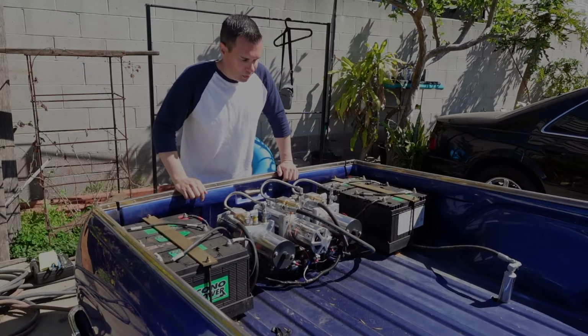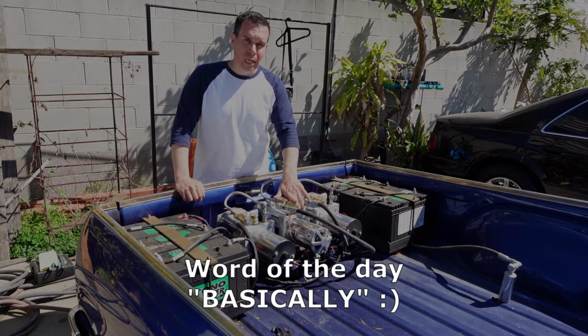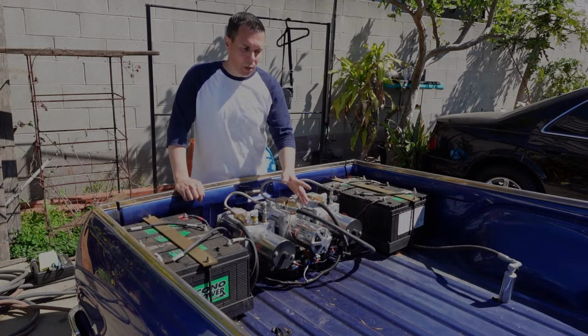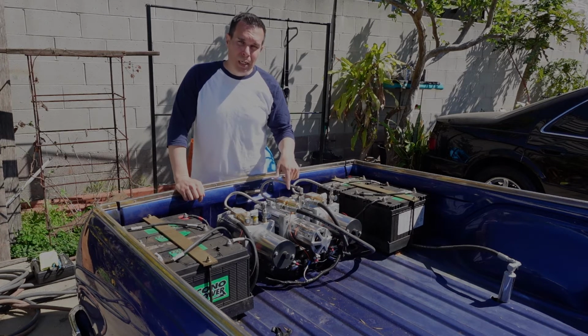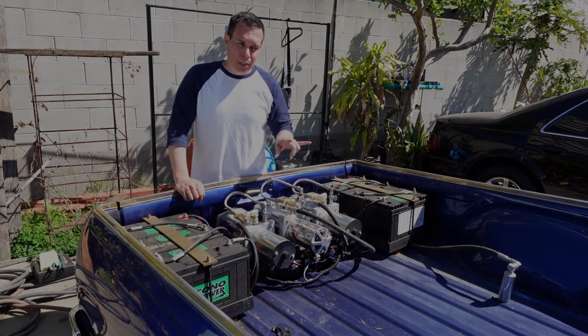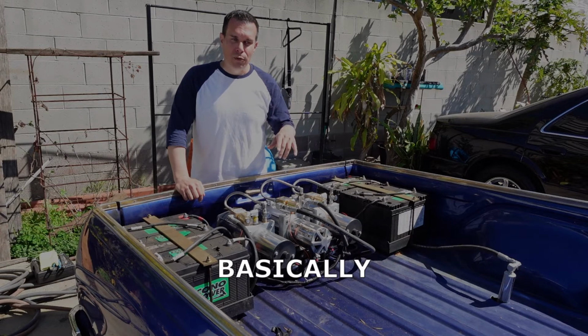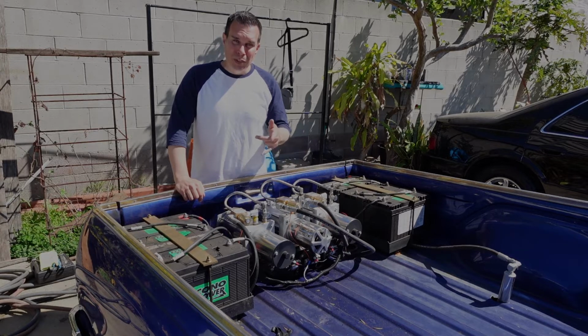All right. So basically what happened is I was working on this car last week. It came in. Same issue, front pump issue. I opened it up, and what I noticed is it's an older block, and it only had two bolts holding the gear on. Most of your newer blocks are going to basically have four bolt holes, and you always want to use all four bolt holes to hold your gear on. On this one, one of the two bolts actually came loose.